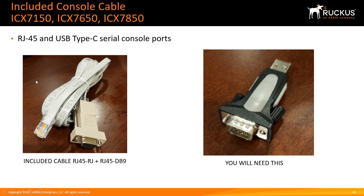What's included in the device is an RJ45-to-RJ45 flat rollover cable and an RJ45-to-DB9 adapter — that's included with every switch. What's not included is a USB Type-C cable, so if you want one you'll need it separately. You're also going to need a DB9-to-USB adapter unless your laptop is very old school. There are a lot of different ones out there and the generic ones pretty much all work with our devices. The one I use is compact and easy to carry.